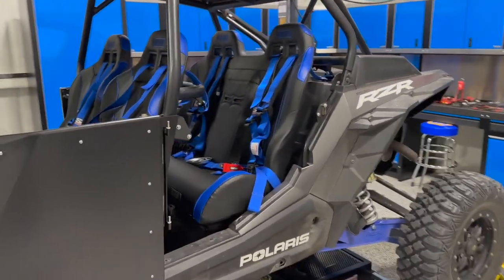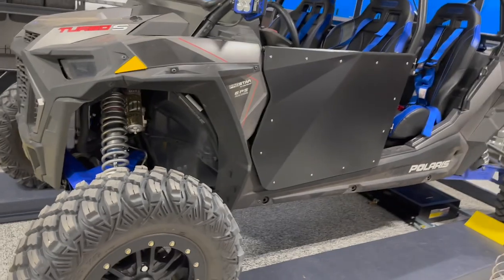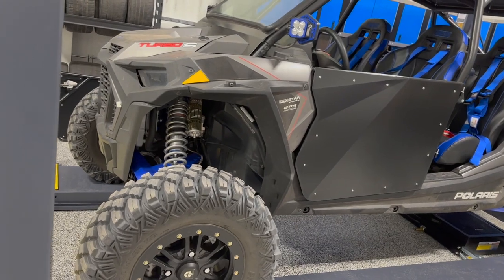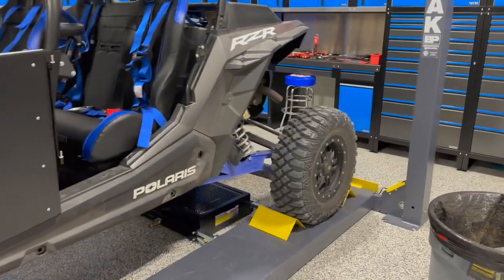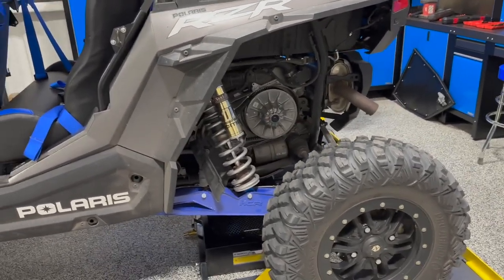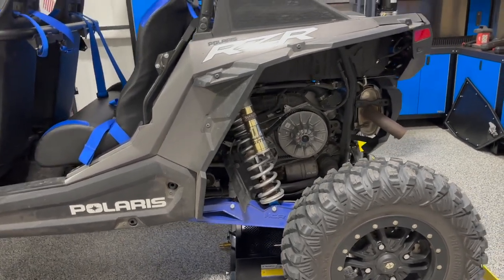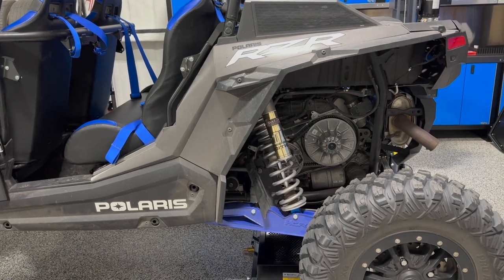I had a good day on the four-seater. I didn't really do any recording — I'm dead tired. I came in late last night and came back this morning and basically did all the fluids. I'm glad I did because I don't think the front differential had been changed. The rear differential and transmission is the same case — it had been freshened since it just got a new transmission, but I went ahead and cycled fluid through it to check for shavings or problems. The big thing was the engine oil — I'm really glad I serviced that because the oil filter had been loosening up, which is apparently a regular thing on these Razor Turbo models.